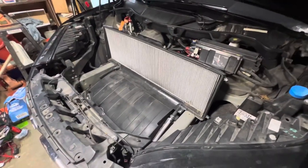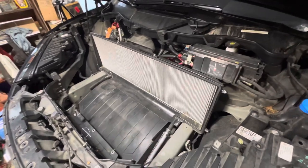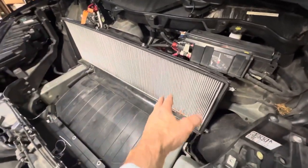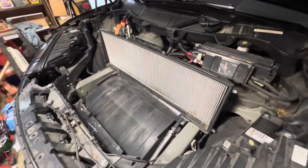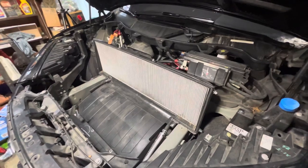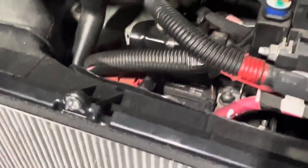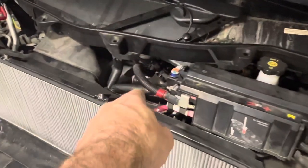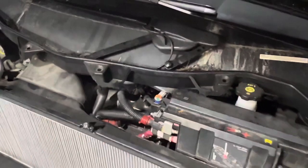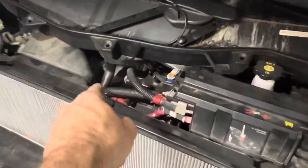Now that it's out, let me give you a little anatomy lesson. This is your HEPA filter — this is on Model X. All Model Xs will have this frame; they may not have the filter in it, but you can buy it from Tesla for about $100. It's your air intake. Some newer Model Ss have it too. Your fuses are here. Your 12-volt battery for all Model Xs is right here — similar location on 3 or Y. It goes bad every three or four years; the warning light inside will tell you. That's only your 12-volt — high voltage is between the tires on the floor pan.